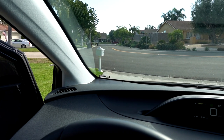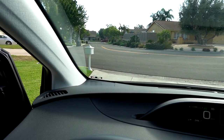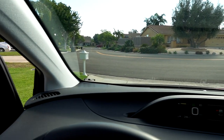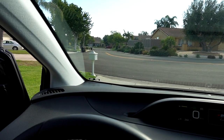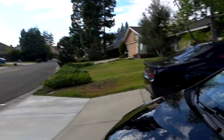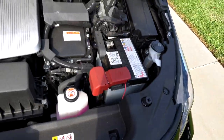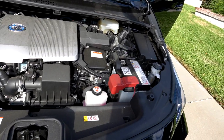What these kickers are going to do — hopefully we're going to find out in a second — is deliver a nice rounded treble sound and separation between the mid-range. When we finally get the doors going, we're going to have the same thing taking place all the way until we install the bass. I'm not installing an amp in this thing. It's already pretty well-powered for any stock radio, and I just believe to get a little bit better sound this will be great. I will install an amp for the sub in a couple weeks, because digging around under the hood — one of the big challenges — is trying to find out where to run that power wire from the battery. In the older Priuses you could get to the battery from under the back seat. Here, that's a nightmare, and the battery's in front.